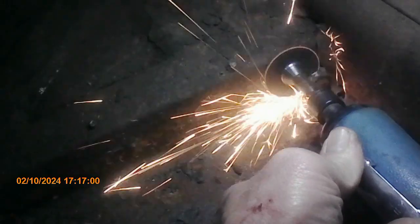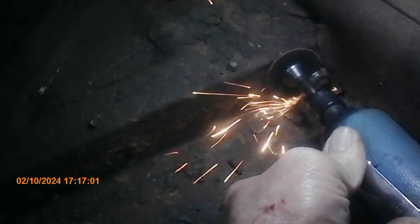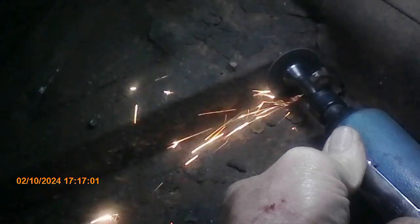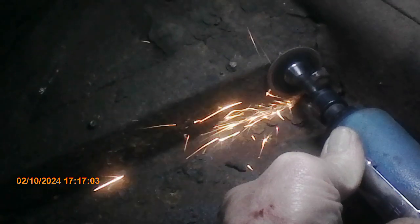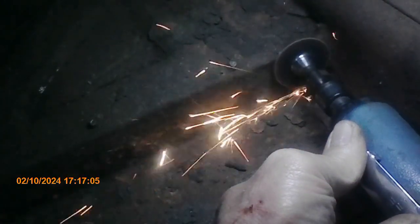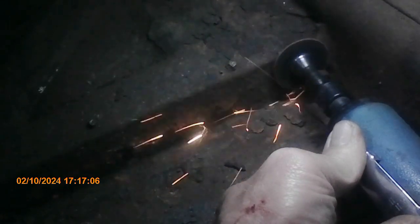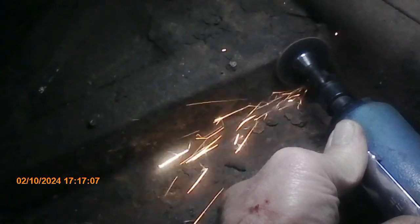So once I've got these out, I can pull the front swing arms off, and apart from taking the brake lines out, I think that's pretty well finished stripping everything off the Goggomobil body. I've also taken the front springs out, which won't be very hard at all, hopefully. So we're getting there. We're getting down to the bare bones of this project. So then we can paint this chassis and rebuild it all. I think it'd be far more interesting putting things back than all this pulling apart.